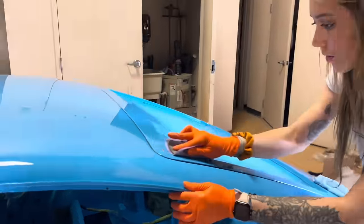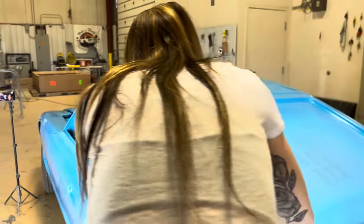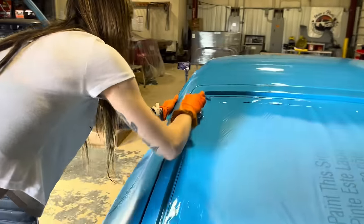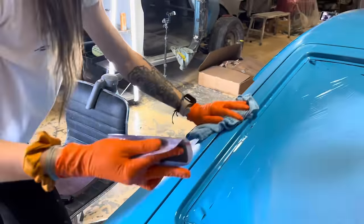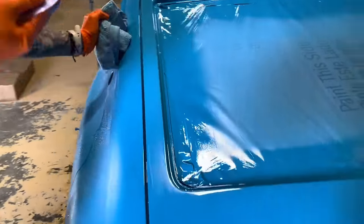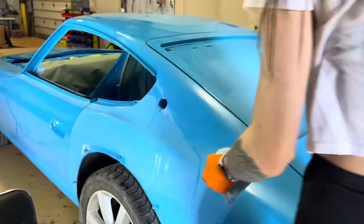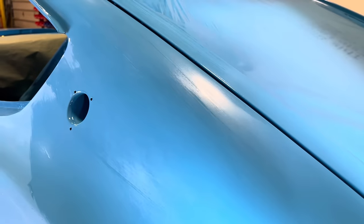The wet sand process now. So Nikki just started. And we do 1500 with a hand block for the first round. And what she's doing is knocking all the texture out, all the orange peel, getting it completely smooth,